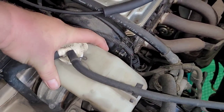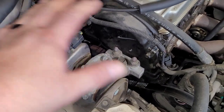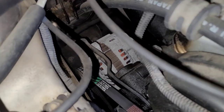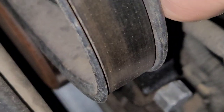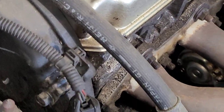First off, I'm not going to go step by step, but you've got to take the overflow bottle out, take the mount out — a bunch of stuff has to come out. These are really not that difficult to do, so I'm not going to show you every little thing. I'm going to start by loosening up the belts. Nice thing is this thing has the adjustment right there — it's got a 12-millimeter bolt and a long adjuster bolt. Down here, that's the adjuster bolt for the power steering belt, power steering and AC. That other one is the alternator.